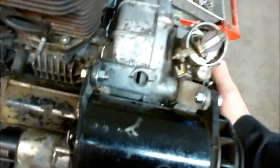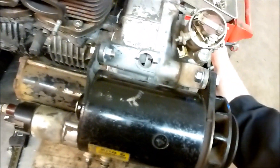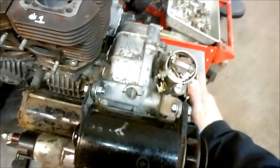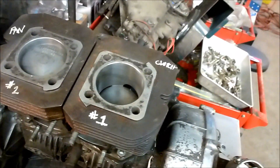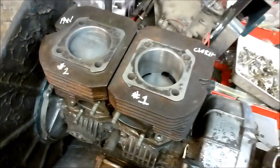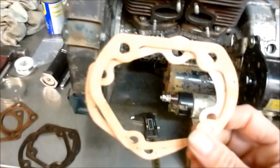The clutch is in there — call it a competition clutch — it has more holding power than stock, and it's paired with the 62 millimeter forged and coated pistons. I've been playing around measuring the port timing and reading up on squish and quench.